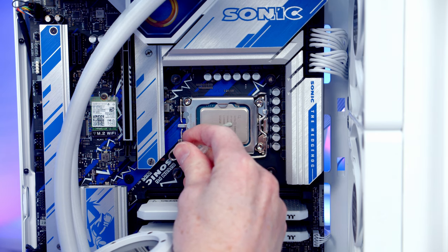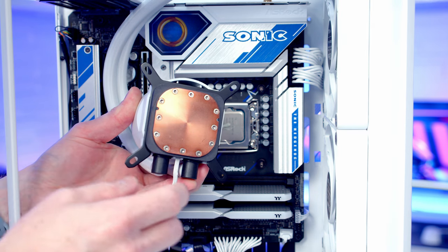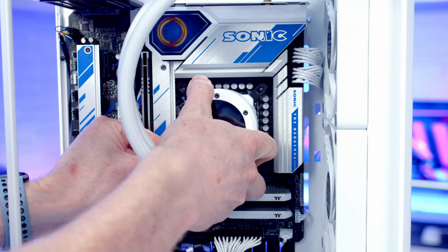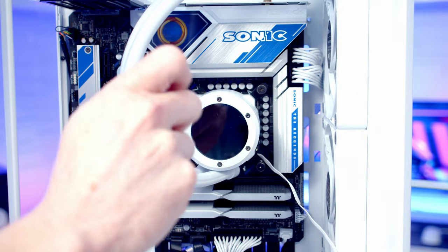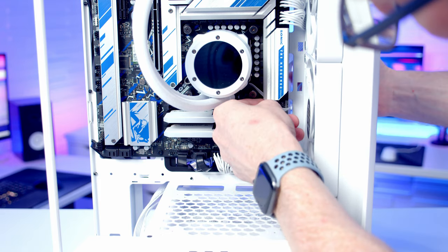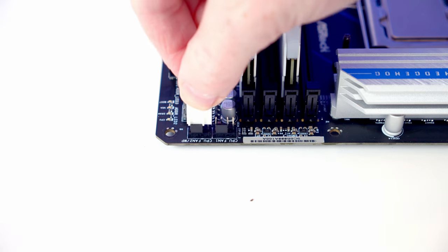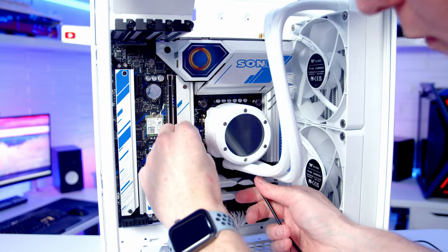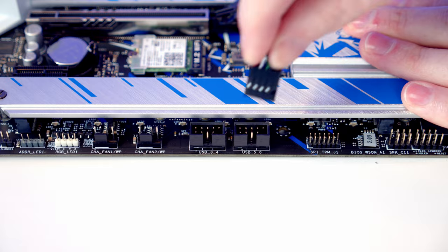Next we add some thermal paste to the center of the CPU — it's included with the AIO. If using the AIO from new, remove the plastic protection from the cold plate. Wrap the pump cable behind the bracket to organize it, then set the AIO onto the bracket on the motherboard and get a thumb screw onto each corner, tightening each one in turn. Route the PWM cable from the pump through to the back of the case alongside the motherboard. The CPU pump header is beside the CPU fan header — bring the cable back through and plug it in. The AIO also has a USB cable that routes under the bracket on the motherboard and plugs into the side of the AIO, with the rest routed to the back and into a USB 2.0 header at the bottom of the motherboard.